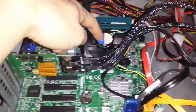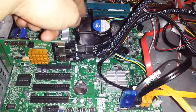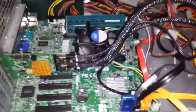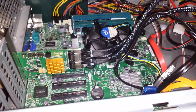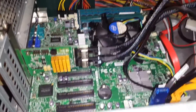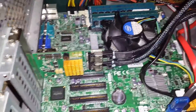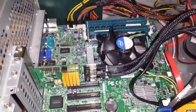This is the G530. These are like MSRP of $35 — super cheap. If you want to get a really low power, low CPU but still want ECC, then that's the way to go. You just need a C204 chipset — they have 202 and others but C204 is the most common — and this is one way to do it. I think they even have an ASUS motherboard, but I like this one.